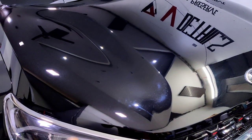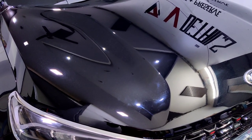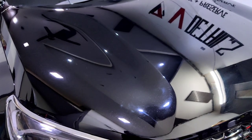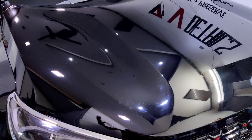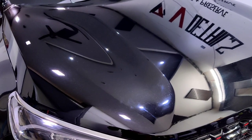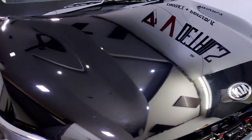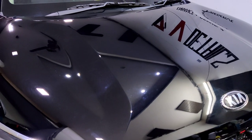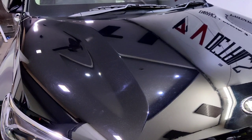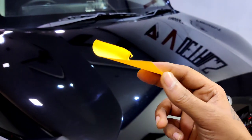117 microns, if I break that down to layers, possibly 70 to 75 microns would be my base color coat, and anything beyond 75 microns is purely the clear coat. So with an average of 117 microns, you probably have just about 30 to 35 microns of clear coat left on this paint surface. That's way thinner than this post-it note.